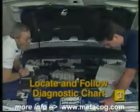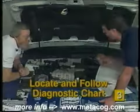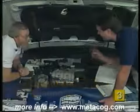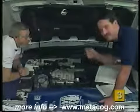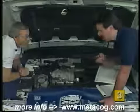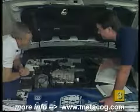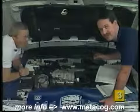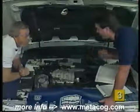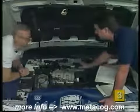So what we would want to do at this time is actually rerun our test, and after that dynamic code came, we snap the throttle, and then we'd want to actually step on the brake pedal once and turn the steering wheel all the way from lock to lock. That's right. And that's because this vehicle actually has a check engine light in it, and we could watch the codes right in there. That's right. Okay. Well, this then would conclude the testing on our vehicle.